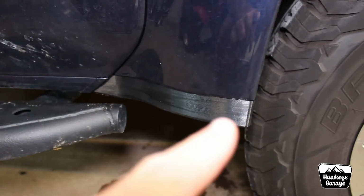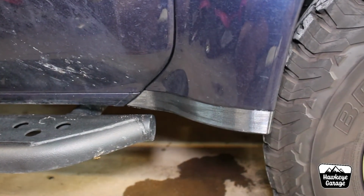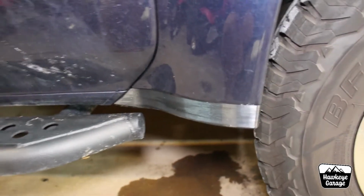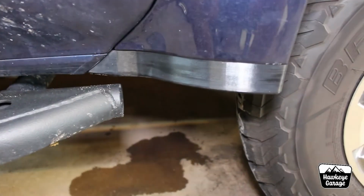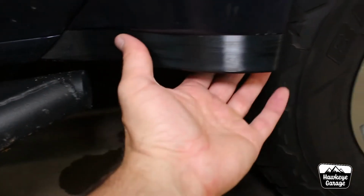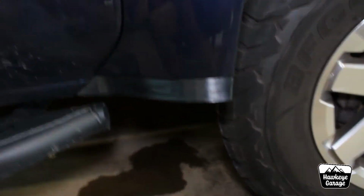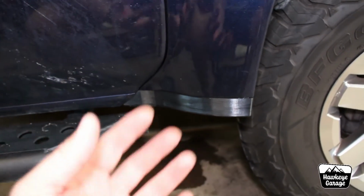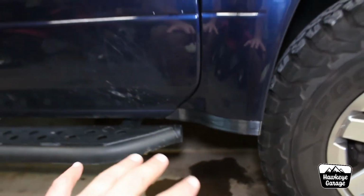Now, when it comes to the clips on the outside, there is like little rubber, kind of like felt almost washers that come on the clips. You may or may not have to take those off depending on how snug they fit on your particular GX. I did have to take mine off, and if you reach up behind here, you can actually access the back side of where those clips go, and I really had to pull and pinch everything together, but that's all right because when they clipped into place, oh man, they fit so snug.